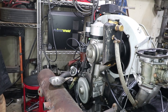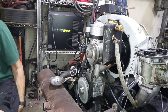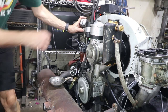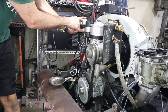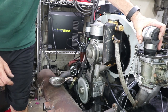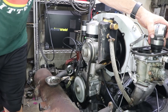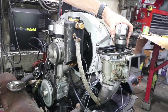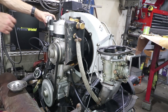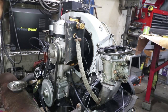It's finally time to adjust the carbs. I've got it running pretty well right now at about 925 rpm, and I'm checking it with the synchrometer. This side is about four, and this side is also about four. So the synchrometer is reading everything the same, and I've got the throttle discs disconnected.